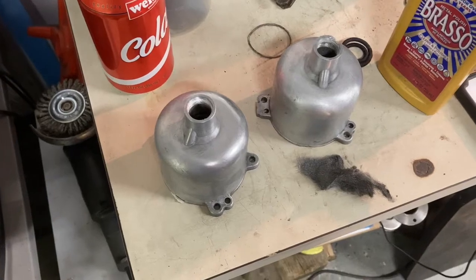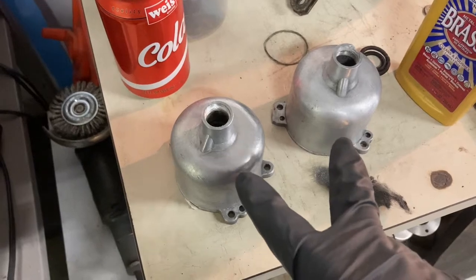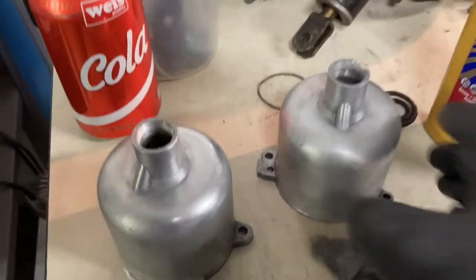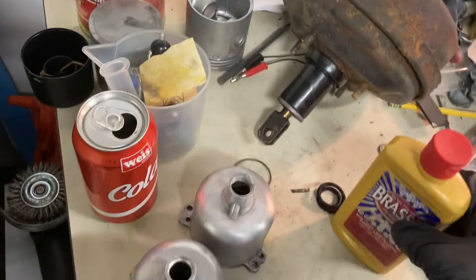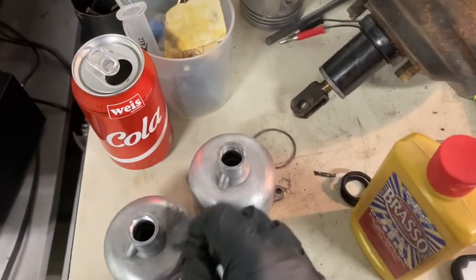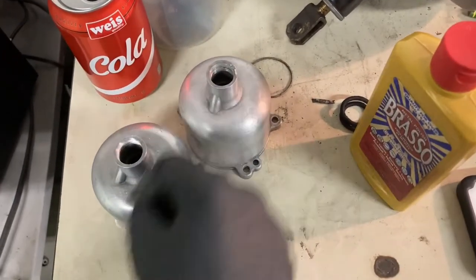I've made the decision to add a step in the process. I've used the mag cleaner aluminum brightener on this, scrubbed it down, washed it off — as you can see, bringing it over to some light it's much brighter, cleaner looking, whiter. Now I'm going to use a brass polish — but aluminum polish works too — using some steel wool, and I'm going to polish the carburetors like such.